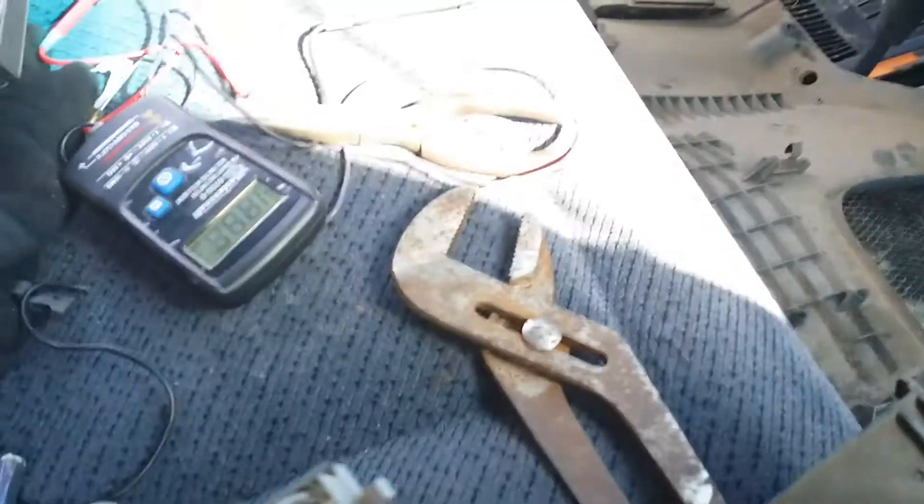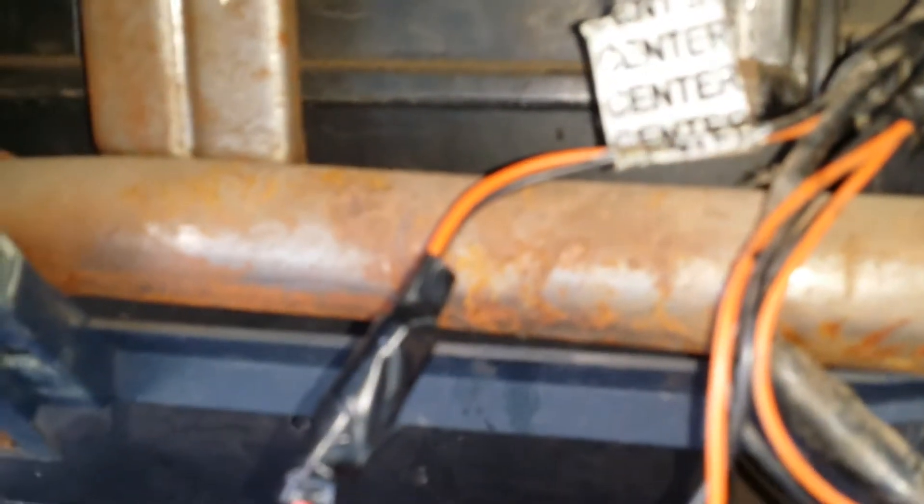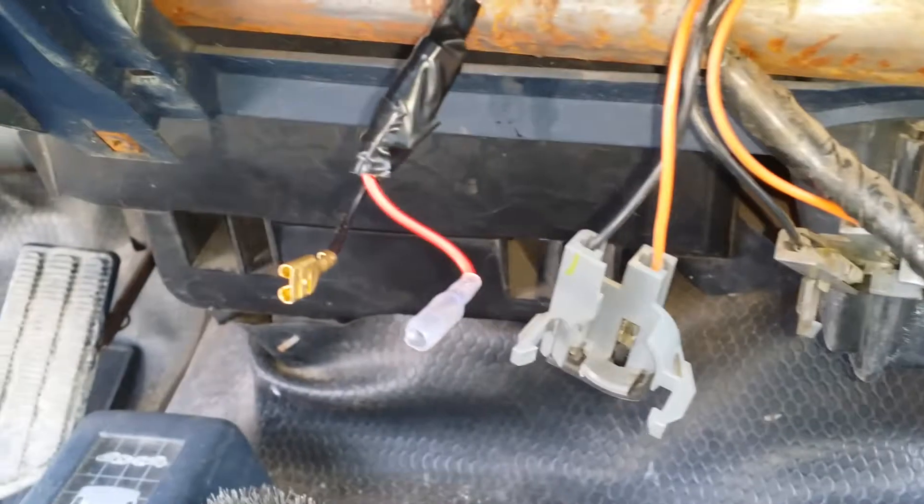I have to change out all my 12-volt accessories. These are the stock ones — they weren't working. Because I was getting 12 volts with my tester, there was a problem in between there. What I'll do is just swap them out with all new ones like this. I already have one wired up and it works fine, flawlessly — it's wired center. I did various testing, switching that gray switch to the left or right, and it still didn't give me power, but now it is working fine.